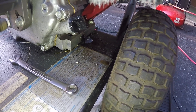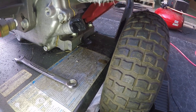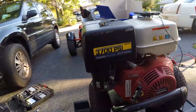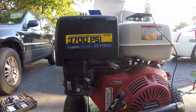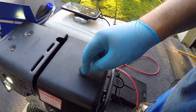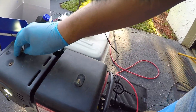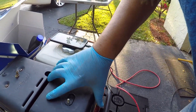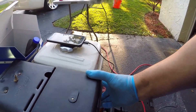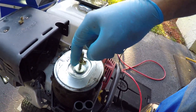That's going to take a little while, so in the meantime I'm going to go ahead and change the air filter I bought for it. The air filter is under here — pretty self-explanatory. I started loosening it already. You just unscrew this wing nut here.